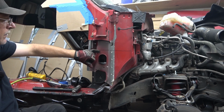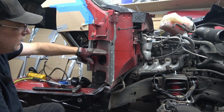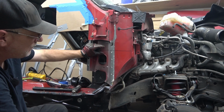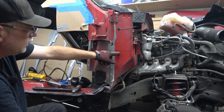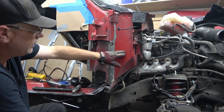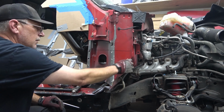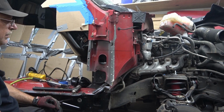There's our line. Now, it was done with a marker, so it could be a little bit higher than it should be. We don't want to have a big gap in here because it'll be very difficult to fill back in welding. We're going to cut just below it, and that way we can refit the new piece in there and get our exact cut mark. So now we're going to drill out these 5 spot welds here and put a cut across there.